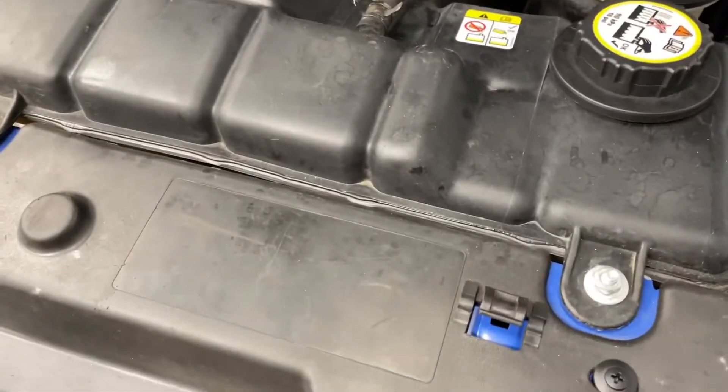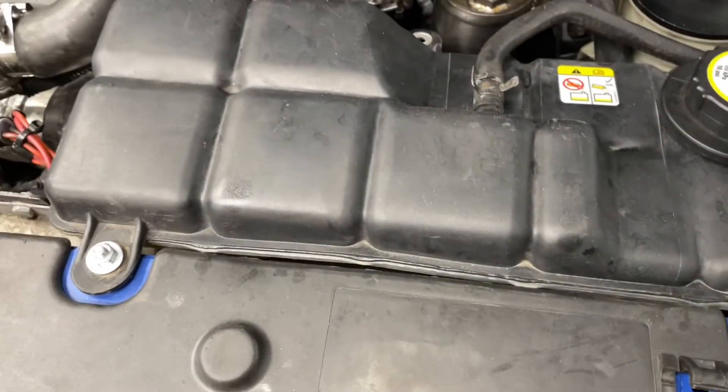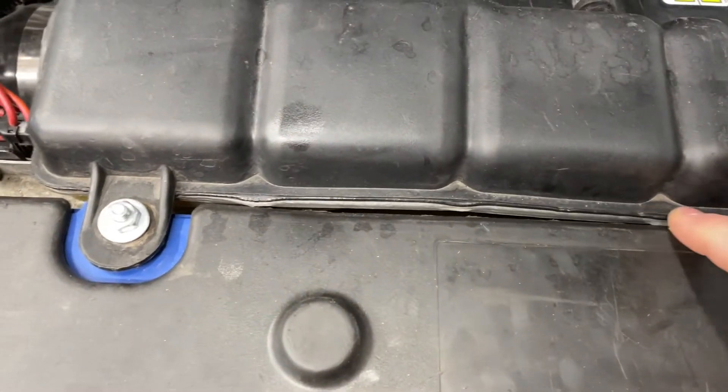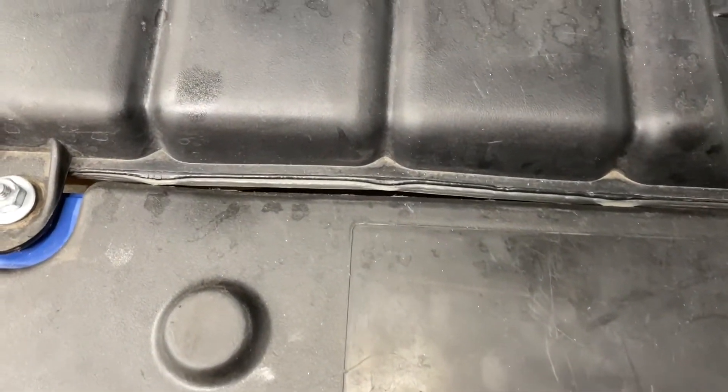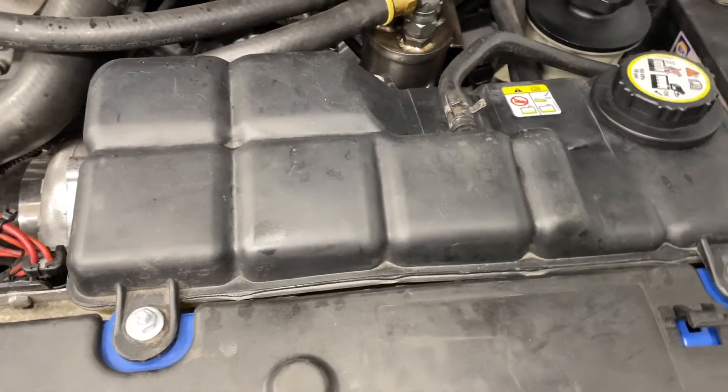I've been noticing that my coolant tank looks like it's getting warped or something from heat. I see that a lot of people end up swapping it out for an aluminum one, or sometimes even people go with a one-off from a Crown Vic. That's what I did because it's actually a little bit smaller, and I think it'll give me better access to the turbo and to my wideband sensor. Here's what I'm talking about — it's probably hard to see, but it looks like it's starting to melt there a little bit, and you can see it's sort of curved here. These are just plastic tanks, made in two pieces and melted together. This one's got a little deformation, and I don't want to take any chances of it possibly leaking, so I'm going to change it out.